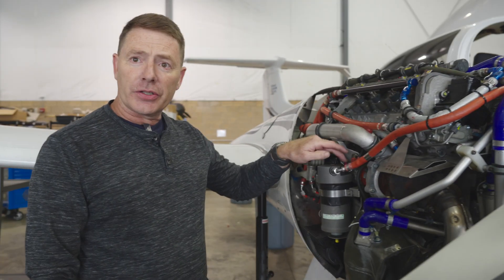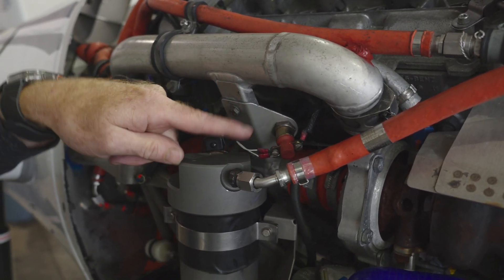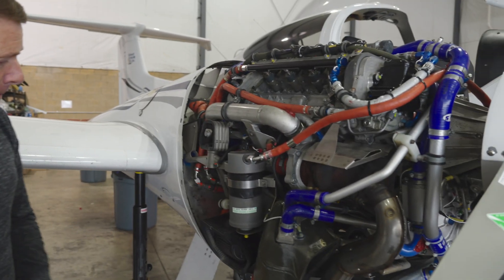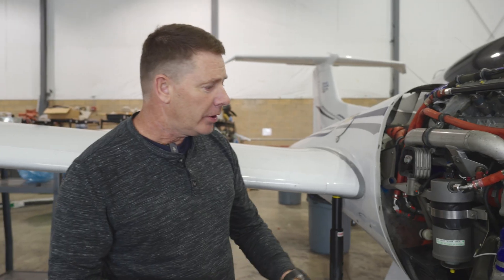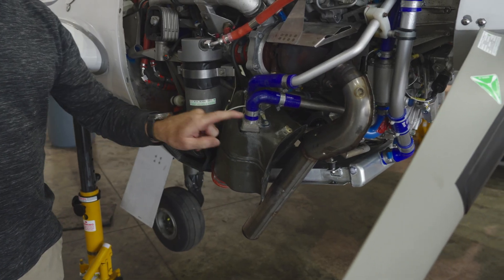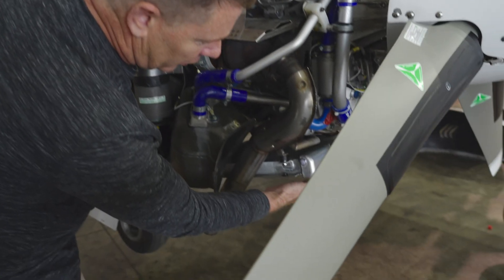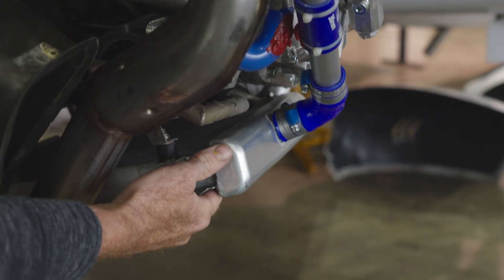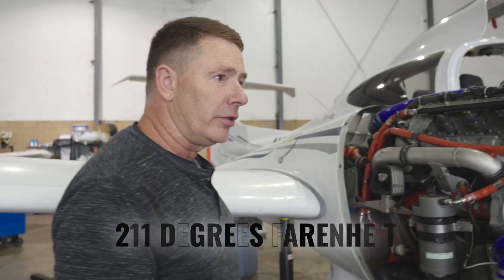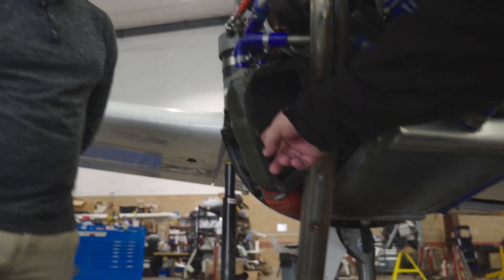This here is a fire detection system. It's a wax system — the wax heats up, turns into a liquid, and completes the grounding circuit to turn on the annunciator light, the fire light, and the bell to alert the pilot of a fire. The airplane is liquid cooled as we discussed earlier. One of your five coolers is an environmental cooler. The right engine is your cabin heat environmental cooler; your left engine is your defroster for the cabin. Cooler number three is a radiator or coolant cooler.